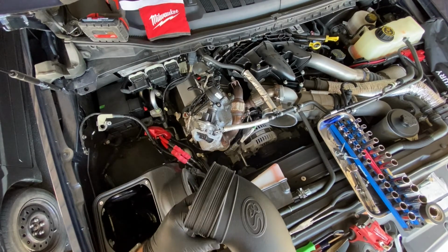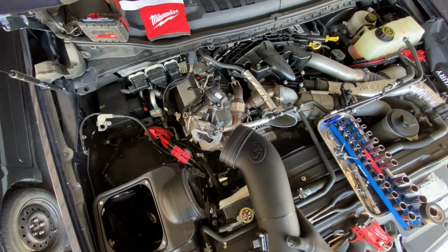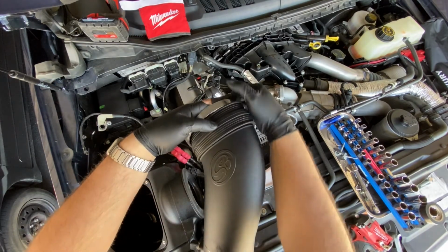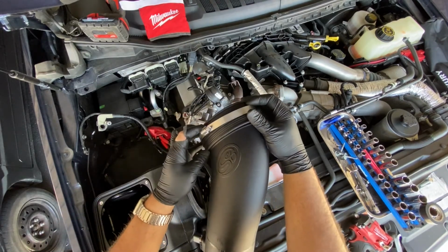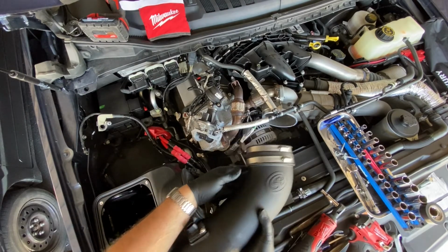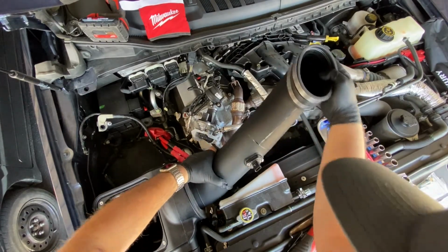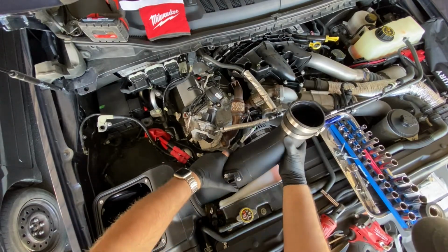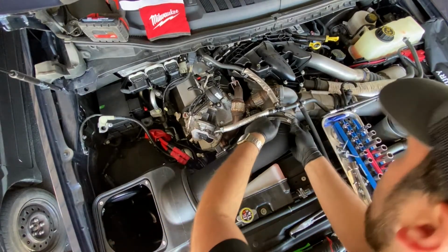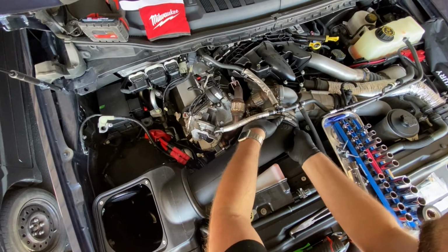install it on the new tube, like so. I'm going to get the new clamps. Stretch those on, install those. That should be good enough. What you're going to want to do now is insert the intake tube into this air box and rotate it. You slide this coupler grommet until you're perfectly aligned with the turbo inlet.